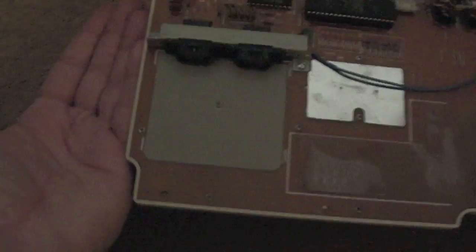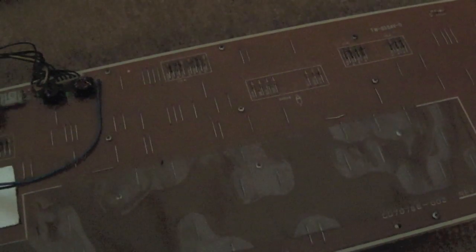When reassembling, make sure all the plungers are in the holes first. Support the keyboard off the ground on both sides using books or something so the keys aren't depressed and the plungers sit level in their holes. Then the PCB just sits straight on. Start with the middle screw, then do corner screws working towards the middle — similar to what I described on the Dreamcast video. Don't over-tighten the screws; it's all plastic fins and you'll damage the threads.